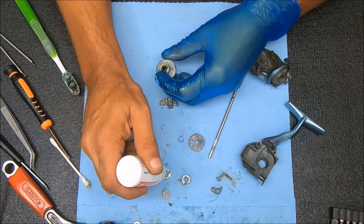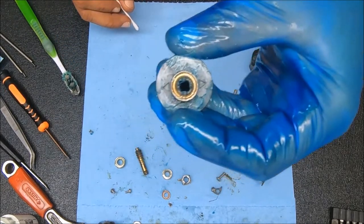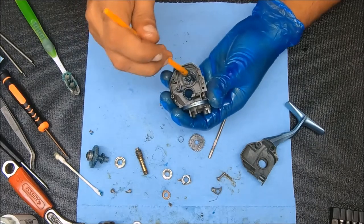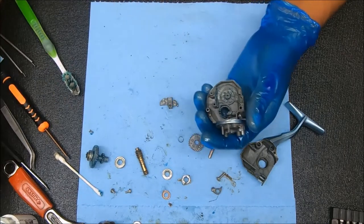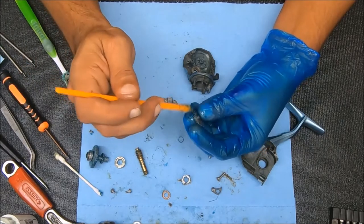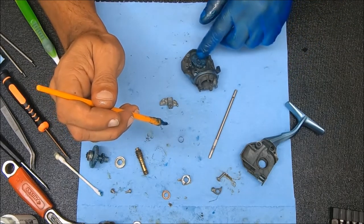That's the pinion bearing right there — I'm going to work that in a little bit, hit the back with some grease. I'm going to try to keep these spots open for you so you can see them. There are two arrows. Let's go ahead and stick some grease inside that hole right there — some around there, some right there, and alongside here. I'm going to drop this bearing inside there, and with the cross-line gear with the dot facing towards the bottom.